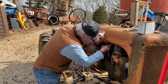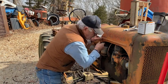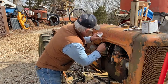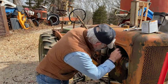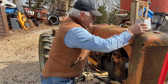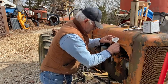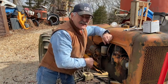Now that I know it's going to have to come apart for sure, we don't really have to soak it to try to get it broke loose before he picks it up. There's absolutely no doubt the motor has to come completely apart. I've also got a C engine on the engine stand right now suffering the same fate — except all four cylinders were full of water on that one. It's been soaking for a couple of years and will also have to be a total rebuild.